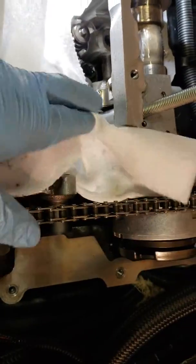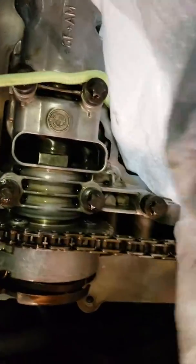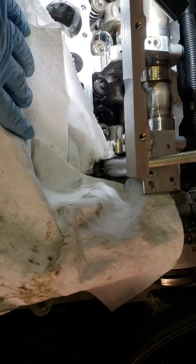What I'm doing right now is rotating. I just laid this stuff all in place so that I can rotate the engine without a second hand holding the chain up. I did the old school method of stuffing some rope down into the cylinder and then rotating it to put pressure on the back side of the valves so that they don't fall down into the engine. This allows me to change the valve stem seals without needing to take the cylinder head off.